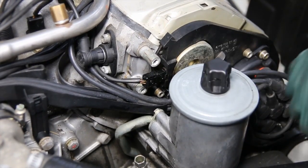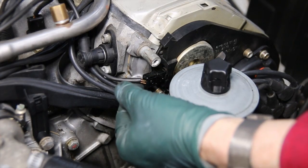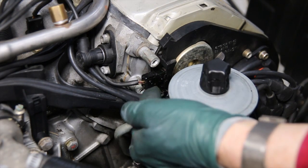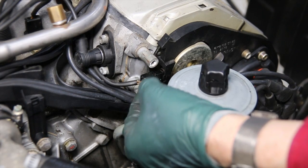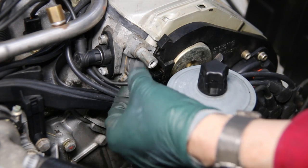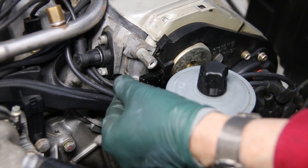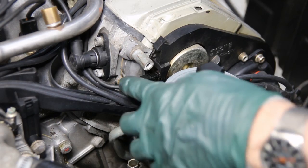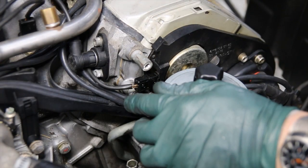Now let's go back to what really concerns me about this engine — that will be part four in the series. When I pulled this cover off, I noticed this wire right away and I said, 'Oh, look at that — the insulation is breaking off.' This is the camshaft position sensor plug. This is a major concern. Many of you have heard of these wire harness problems on these 1990s era Mercedes-Benz. What we're going to have to do in the next video in this series is do a complete inspection of the whole wiring harness in this engine compartment.